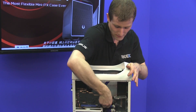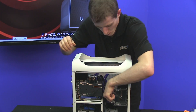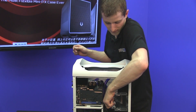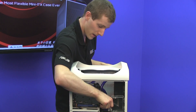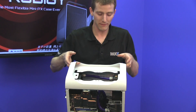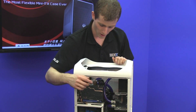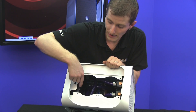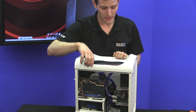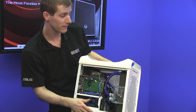There's one other positioning thing that's actually pretty important to make it easier to bleed the system of air — to get all the air bubbles out. Air bubbles affect the performance of your water cooling components and the noise that they make. The way I've put the radiators in the loop: this one has both the inlet and the outlet at the top, which makes it easier for the bubbles to get out and move to the reservoir where they will be collected. On the other side, I've used the top as the outlet and the bottom as the inlet, again so the air bubbles can more easily be passed through to the next component. Now that we've installed this last compression fitting, we are pretty much done with the actual installation — all that's left is to fill it up and turn it on.